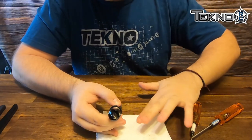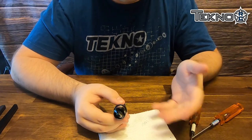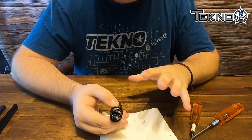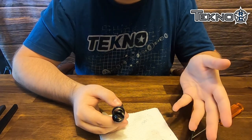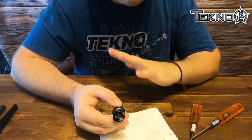The more important part is whichever way you've been doing it or whichever way you decide to do it, try to do it like that every time. When you change shock fluid and things like that, if you build it differently it's going to make your shock fluid act a little bit differently. So if you want to keep it consistent and actually know what the changes you're making are doing, build it the same way every time.